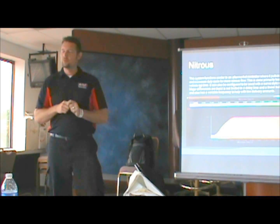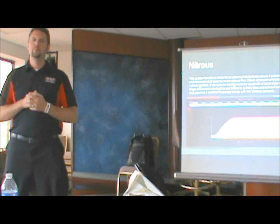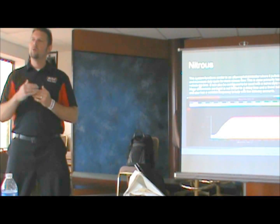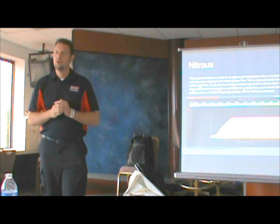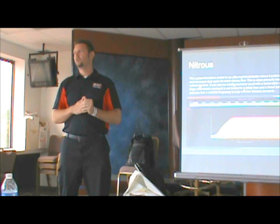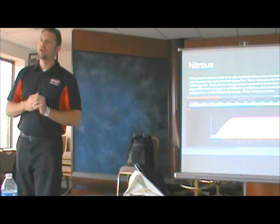One of the other things that we're doing is controlling the frequency, which there's some ongoing testing and it's limited to the solenoid types, but being able to deliver low amounts of nitrous is largely dependent on the frequency that you are pulsing it at. So as you lower the frequency, you can have a little bit better control of the lower duty cycles, the lower, sort of 50 horsepower and below nitrous delivery.